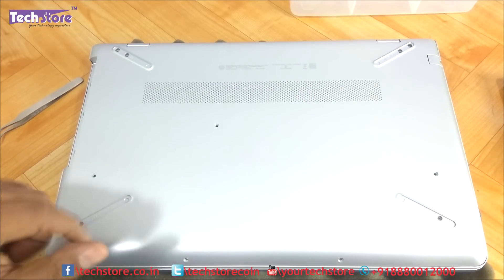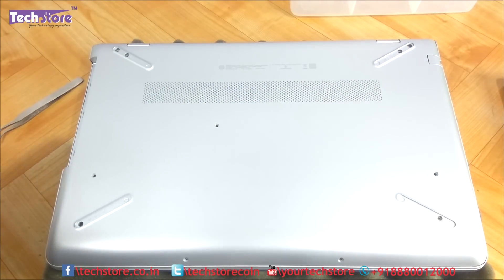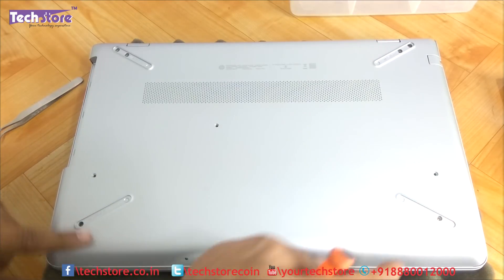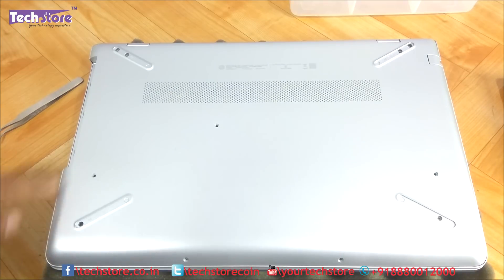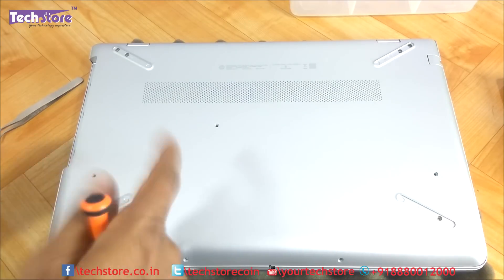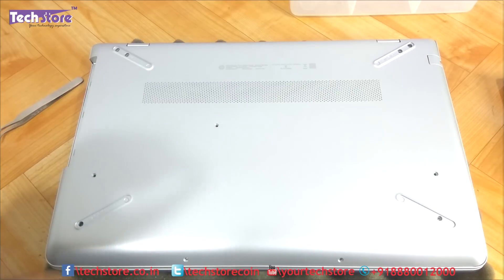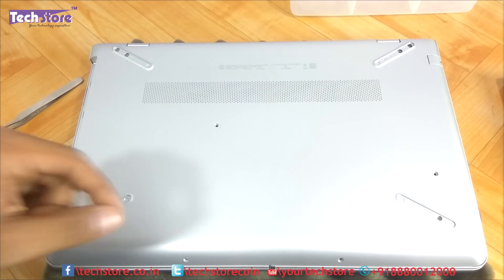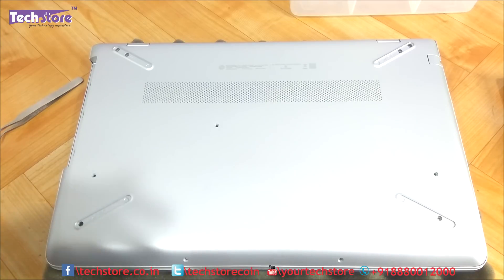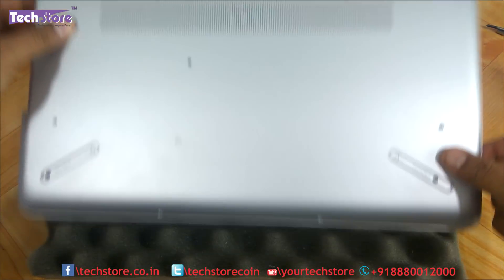You should know there are different screws for different compartments. The hinge screws are entirely different. The four screws in one area are smaller, and the three screws in another area are longer and different in size — so three different screw sets total. Be very careful, because inserting the wrong screw could protrude into the touchpad area and break it.